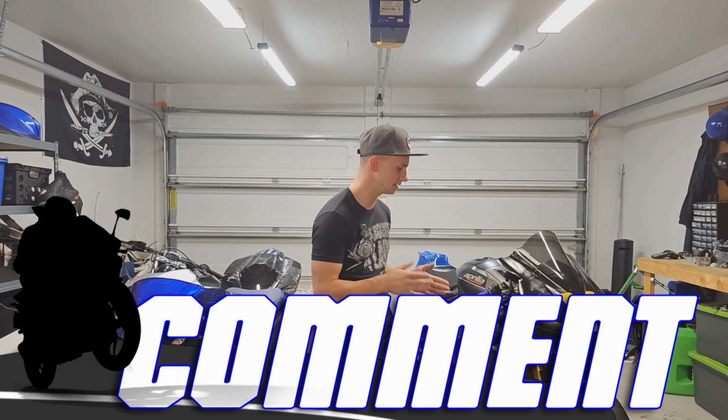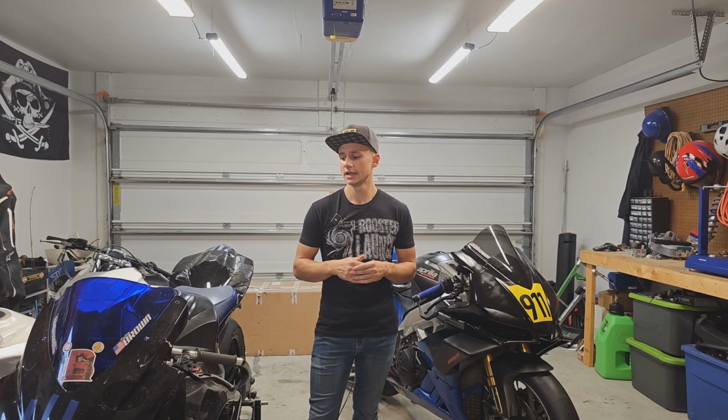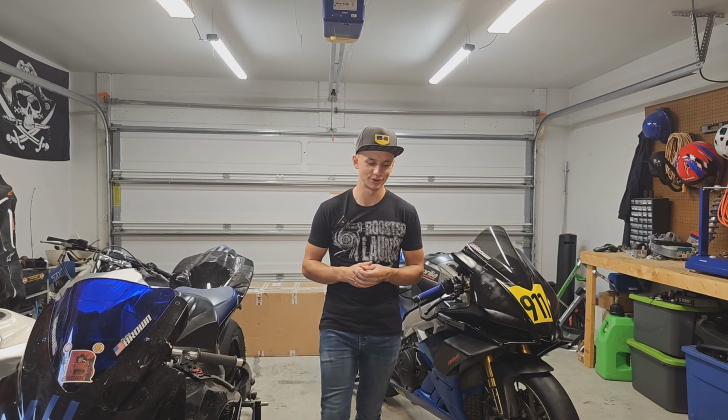We bring our bike in, get it up on the stands, get the battery on a charger, a tender of some sort, get your coolant changed out for something that is anti-corrosive, especially get the water out of there, and then don't worry about your oil too much. Unless you're due for an oil change, go ahead and change it. Get some lube on your chain, you'll be good to go. Just make sure your tires stay nice and warm over the winter. You don't want those hardening up.